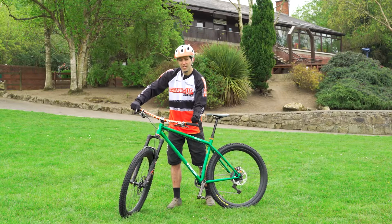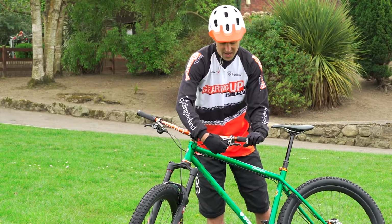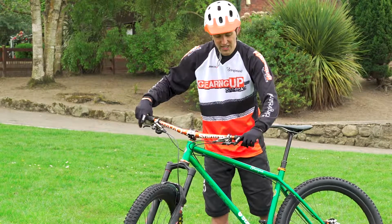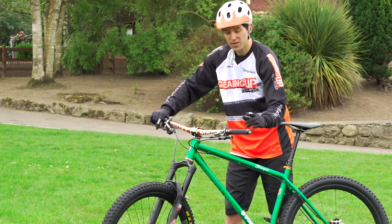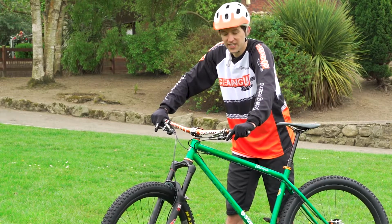Finally, if they've got small hands, then you'll normally find some kind of adjustment here, and you can actually adjust that lever in closer to the handlebar, so it's easier for them to keep the brake covered. You're going to encourage them to ride the whole time with 1 finger, just sitting on the brake, so that it's always there to pull when they need it.